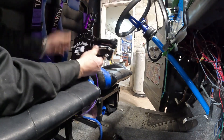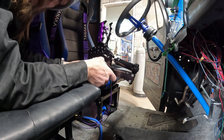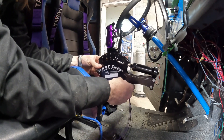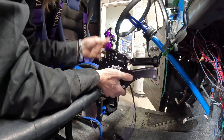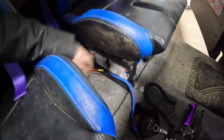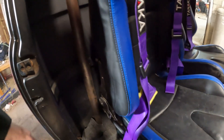We've got our Motion Race Works CO2-assist shifter here for the Turbo 400 or the Powerglide — it goes to either one. I need to mount it right about here somewhere. I'm going to build a bracket coming off the seat mounts, and then it'll come up and out and hold onto it there, keeping everything clear. I'll put the CO2 bottle back there on one side — haven't decided which yet. Because yes, we are putting a 150 to 300 shot of nitrous on this bad boy just for the big end.